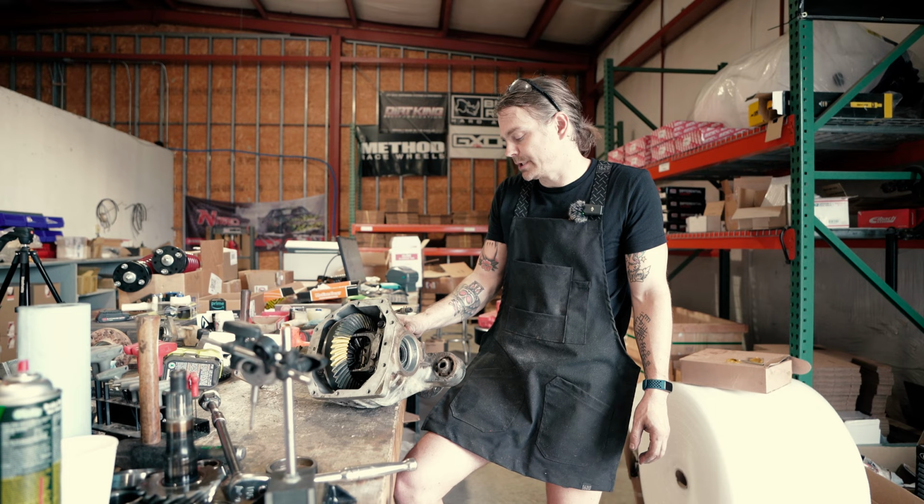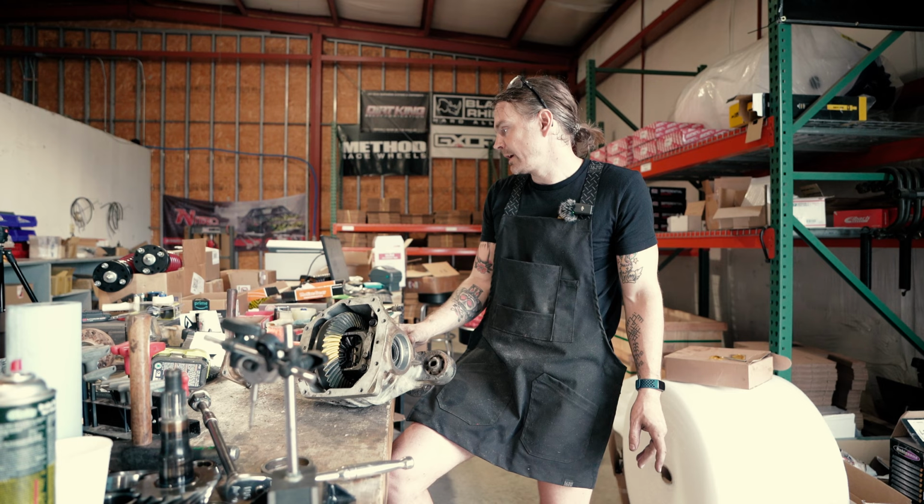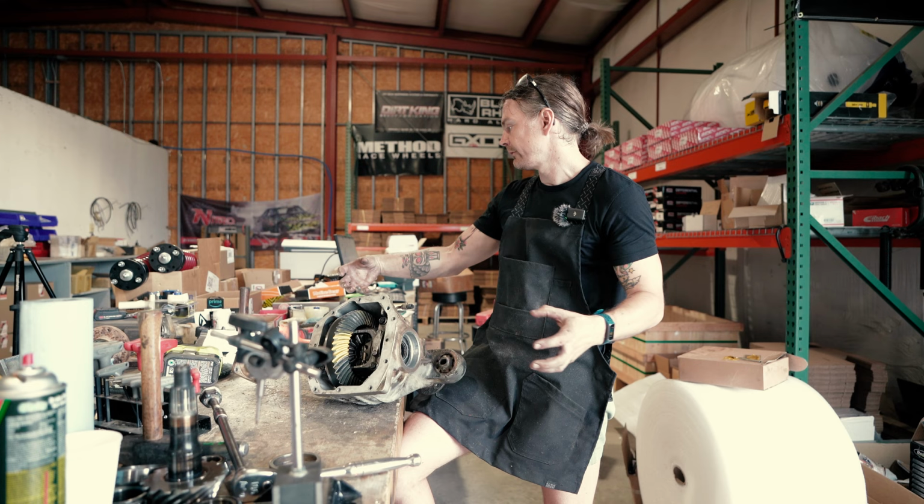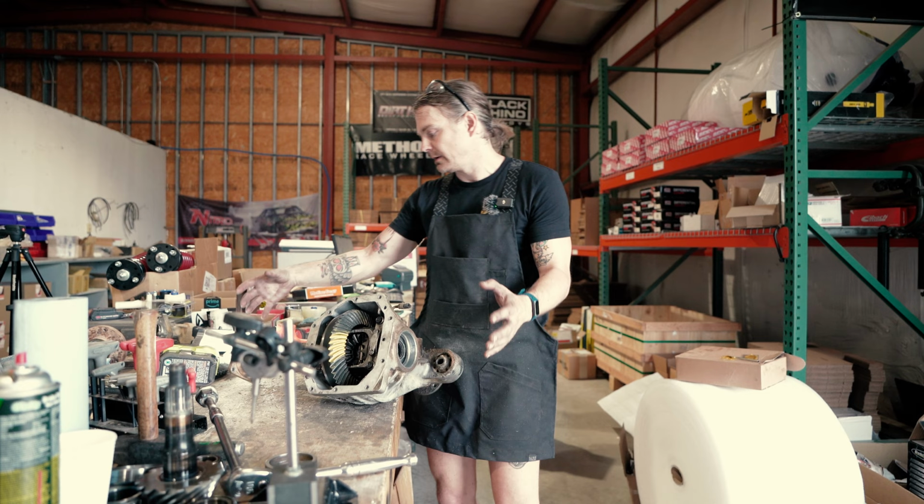It's not gonna be much different from tearing it down. I'll put the passenger side stub of the housing in and the stub shaft. I'll probably get some new seals, actually. The master rebuild kit came with a pinion seal. It did not come with the outer seals here. So I'll have to get those from our local Nissan dealership. Other than that, it's pretty much done.